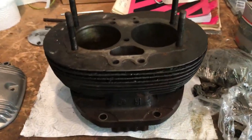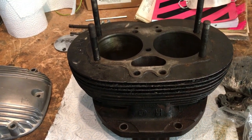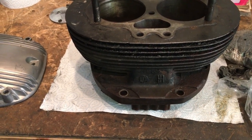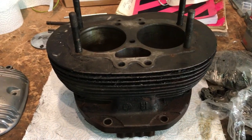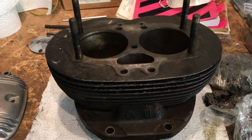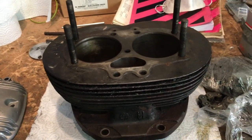The more major news is the barrels. The original barrels off this bike are the later barrels with the 3/8-inch stud fittings, marked up with what looks like a part number - 711033. The original barrels were damaged on the skirt on the left-hand side where obviously the rod tried to let go. Those barrels are currently having new liners put in and being bored out to standard, however that's going to take a little longer than anticipated.